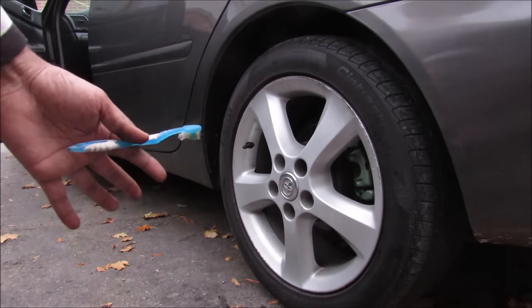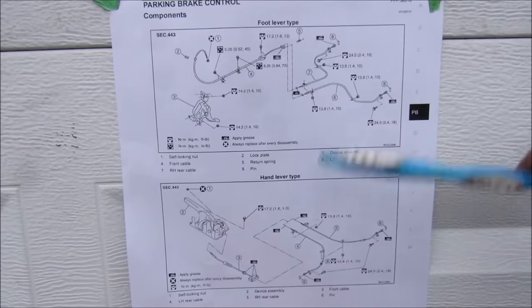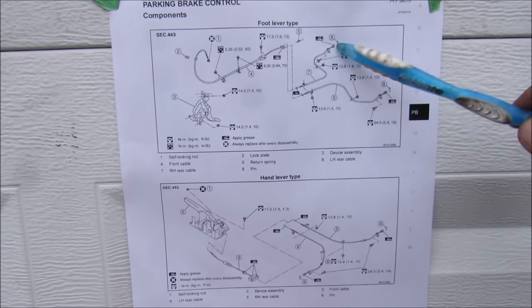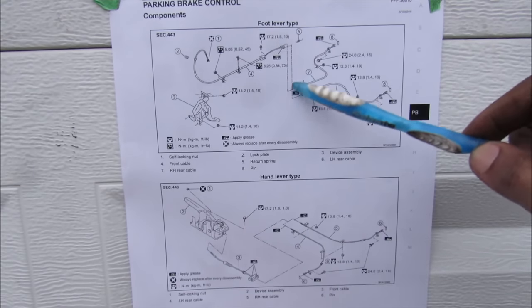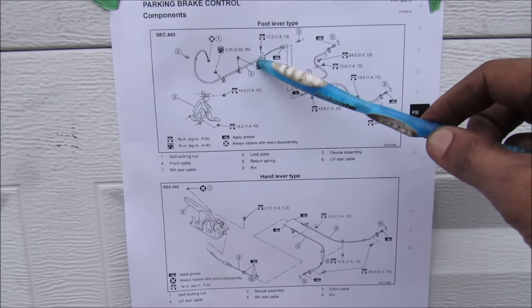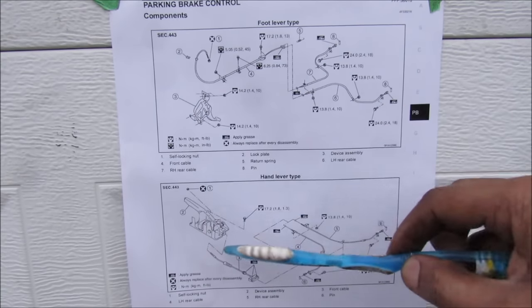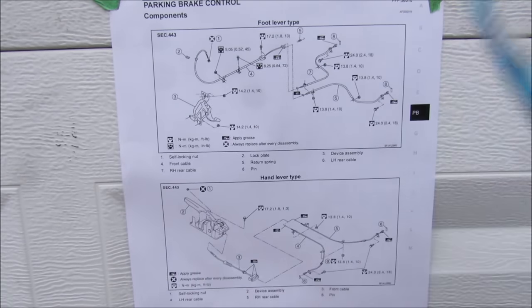Watch when I actuate it while rolling forward. Now some vehicles have two different types of actuators: the foot brake and the hand brake. At the rear they're the same, with two separate lines joining at a T-connector before going into the body. Inside, there's an extended line that goes underneath the dashboard for the foot brake, whereas the hand brake just has a very small patch line.